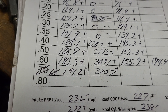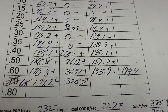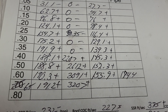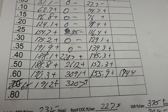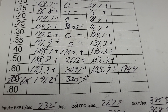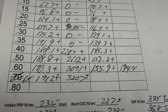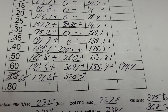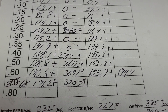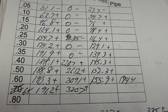In the comments let me know what you want to see me do on these — I'm going to have to go through with the sonic and start taking some measurements. If you wanted to do this for a street engine — meaning street lifts, anywhere between 500 and 600 — take those numbers, run them through a calculator, and give me an idea of how many horsepower you can make with this head as long as you feed it correctly. I think it might surprise you — knocking on 400, I would think, depending on how you do it.